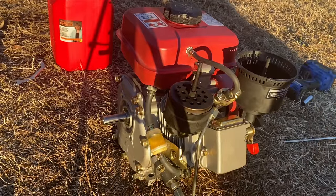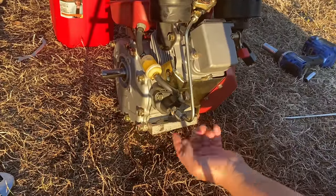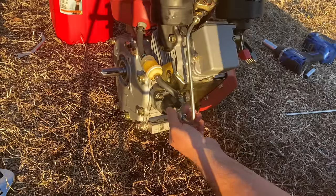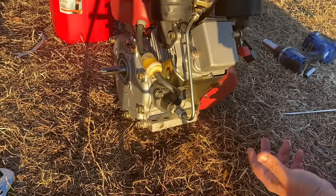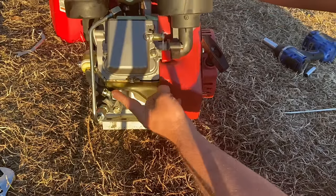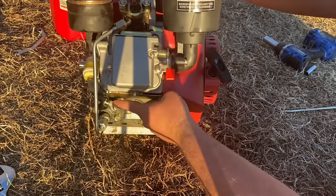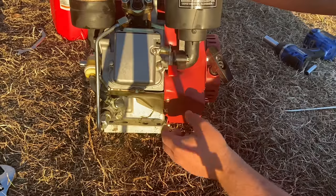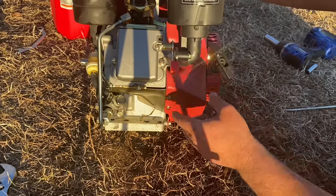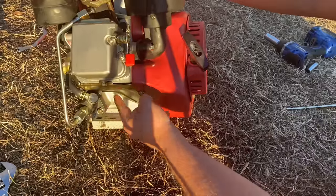All right, so I've been messing with this thing for quite a while now, trying to prime the fuel. I took this off, and I was getting fuel there when I removed all the internals, but I couldn't figure out why, when I screwed it back in, I couldn't get any fuel. One of the issues was that I'd also taken this off here, and this bolt has two holes in it, and then it empties out into the center. But if those holes aren't lined up with the little banjo fitting here, the fuel can't pass down into the injector here. So I made a little mark with my file so I know where the holes are, and make sure I line that up.